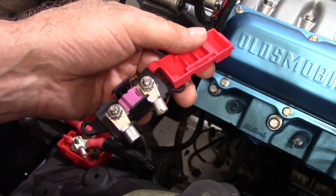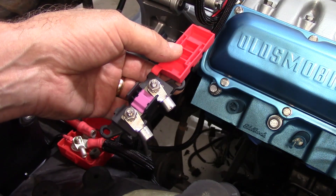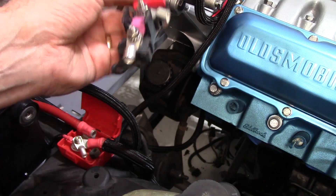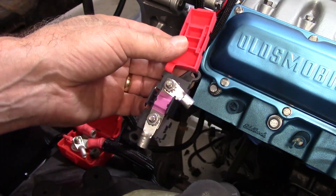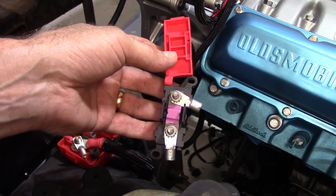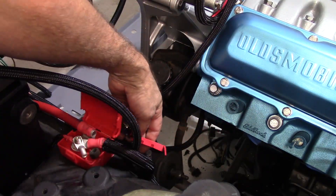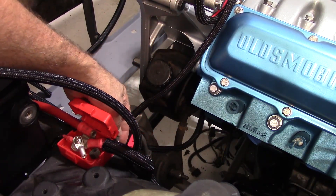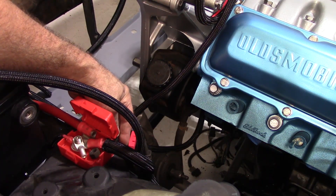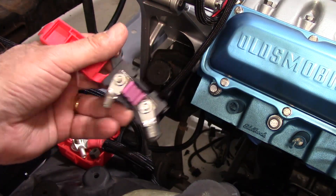It's really listed as a heavy-duty alternator system, like 170–190 amps, and this thing's only 105 — it's a factory Blazer alternator. But I'm still going to put it on. Who's going to argue with me being too safe? So this will go down here just below where the junction box is, and I'm going to bolt it right to the side of the plastic housing. Hopefully the screws it comes with will bite into this plastic and hold it in place; if not, I can bolt and nut it from the back.